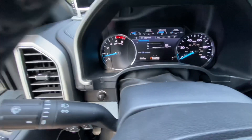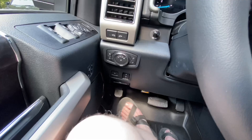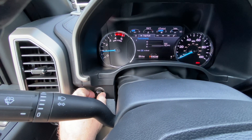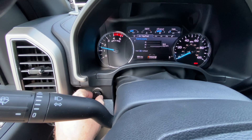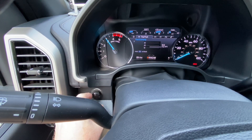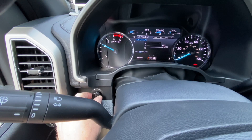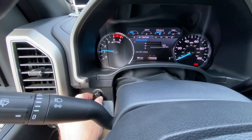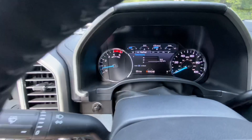The truck is running now and you will notice that when you twist the knob, nothing happens. That is because the parking brake is not set. Once the parking brake is set and you twist the knob, you'll notice that the further clockwise you turn the knob, the higher the idle will be. The range is anywhere from no high idle all the way up to 3000 RPM. There's a little bit of delay from when you turn the knob to when the truck responds, so be patient and turn the knob slowly. If you touch the brake or release the parking brake, the high idle is disabled and the truck will go back to normal idle.